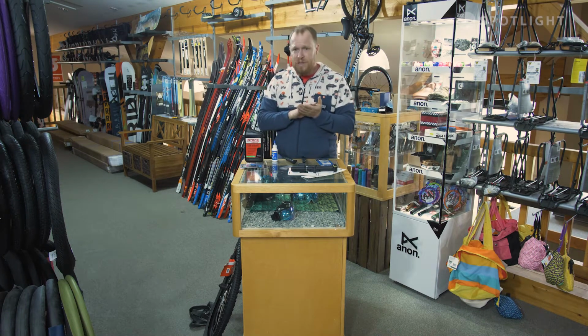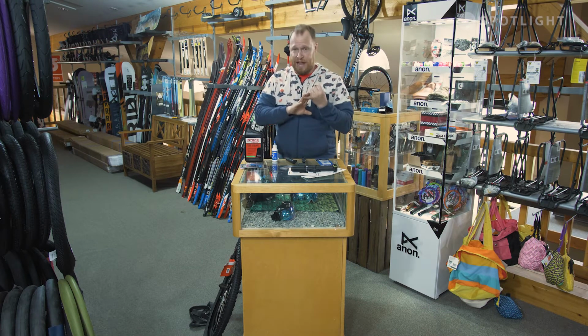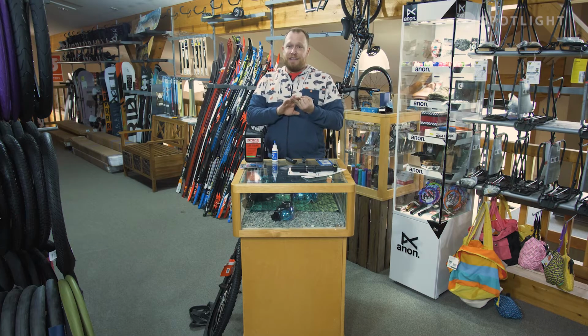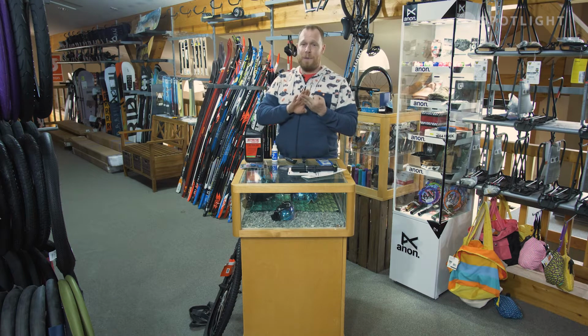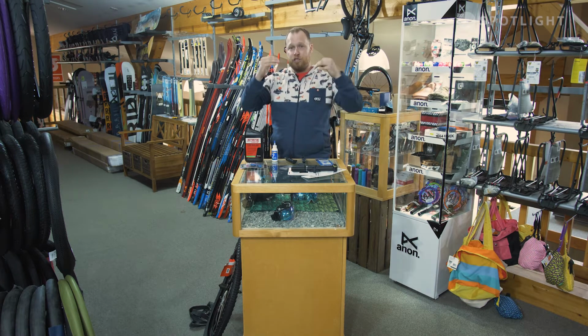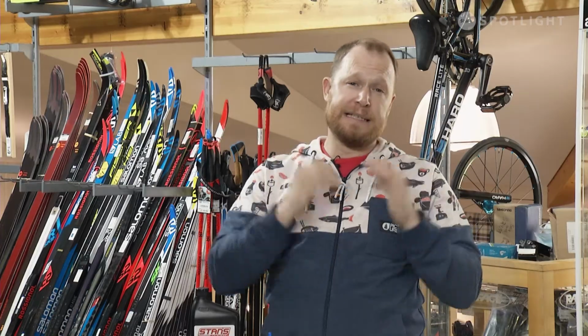So we've gone over that tubeless fixes flats for you. It gives you better control and grip on the trail, whether you use that to go faster or just to be more stable on the trail. That's completely your choice. And the third thing that I really like about tubeless is that when I'm running tubeless, I check my air pressure every single ride. If you have consistent air pressure in your tires, you will ride smoother and better.